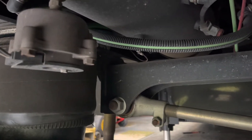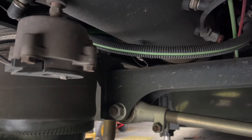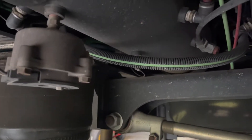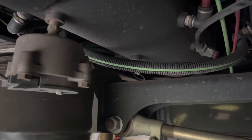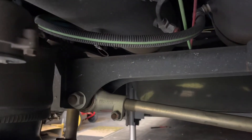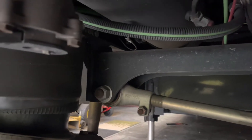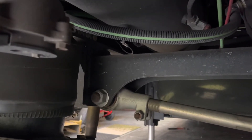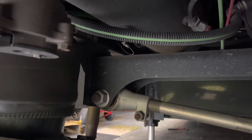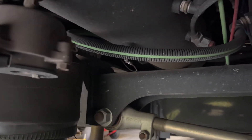The first thing you want to do is get your motor home in a quiet place, preferably not near a freeway or anywhere with a lot of noise. Walk around it — there are usually little telltale signs of hissing noises around your coach. Once you walk around your motor home and assess the situation, you can start narrowing down where the leak is coming from.